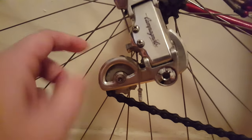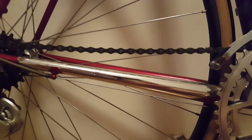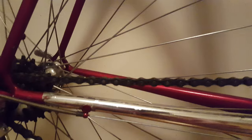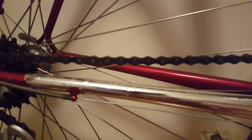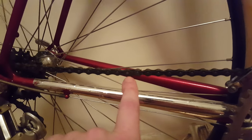To summarize: problem number two is the spring located right here on the derailleur — that's what gives you the saggy chain. Problem number three, which is not the case in this situation, is the chain itself. The chain here is pretty much brand new, but I'll put a link in the description on how to measure it and see if you need to replace your chain as a last option to fix the saggy chain issue.